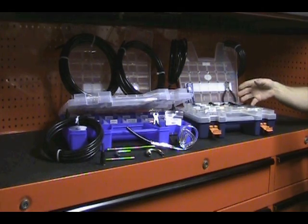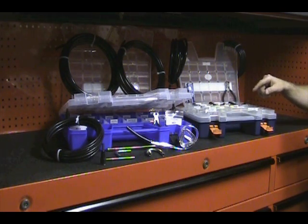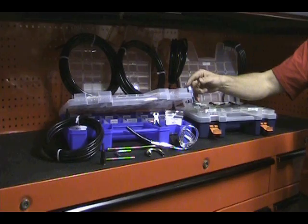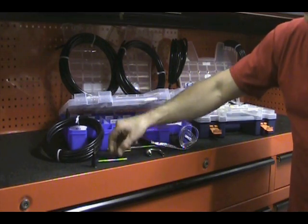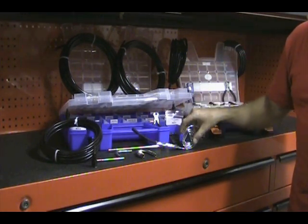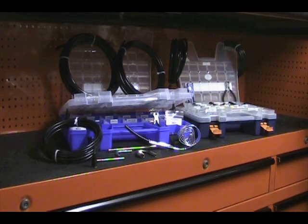The KP-1200 is our most popular kit. It covers over 75% of both domestic and foreign applications, and this kit pays for itself in as little as one to two jobs. We also have the KP-1500 master kit, which provides over 95% coverage. This kit includes an expanded assortment of fittings and adapters, such as quarter-inch quick connects, quarter-inch tubing, adapters, 90-degree adapters, extra-long GM adapters, 180-degree fuel filter adapters, and also a heat shield which protects tubing up to 1,200 degrees Fahrenheit. Both kits come in a convenient carrying case labeled with part numbers and descriptions, making choosing and reordering parts simple.